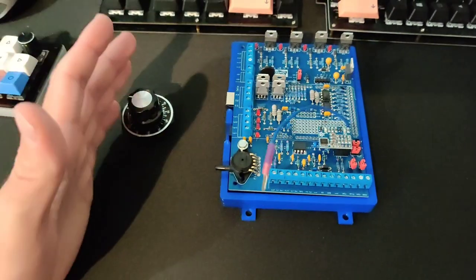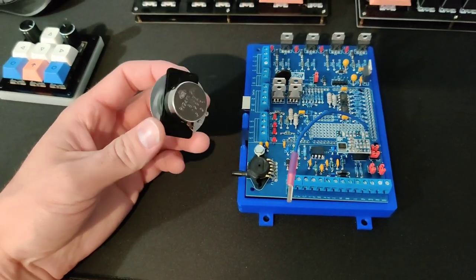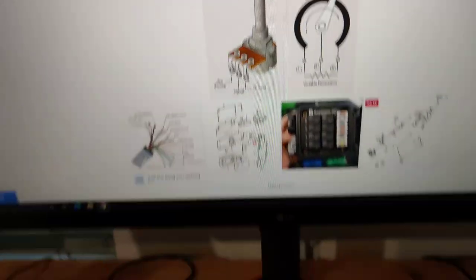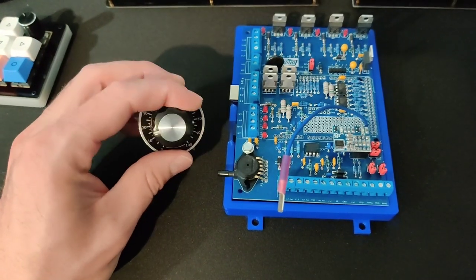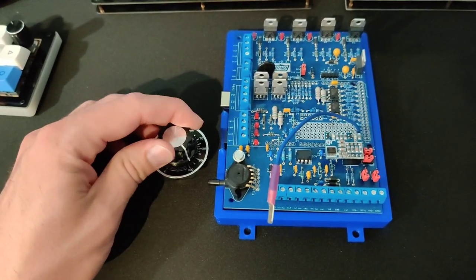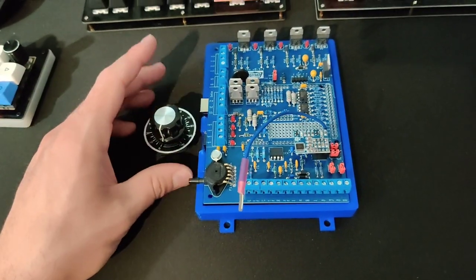It's really that simple. Many aftermarket ECUs and OEM ECUs use the same method and it can be very simple. You could even rig a potentiometer from eBay or Amazon to work on a throttle body, though there are dedicated throttle position sensors that work best. Even on a carburetor, you could rig a throttle position sensor if you needed to data log. It's really one of the most basic sensors on an engine.